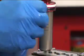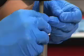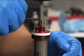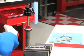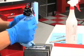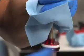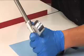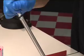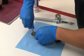Insert a new white compression ball into the bleed hole. Using a 2 millimeter hex, gently thread the bleed screw into the bleed hole until you feel it touch the white compression ball, then tighten an additional one-half turn. Spray the assembly with isopropyl alcohol and wipe with a clean rag. Remove the shock from the vise. We've mentioned nitrogen a number of times, but you can use air for this next step. Using a gauged pump and the Monarch valve adapter, pressurize the shock body to 200 to 300 psi. Use a Schrader valve tool to reinstall the nitrogen port cap.